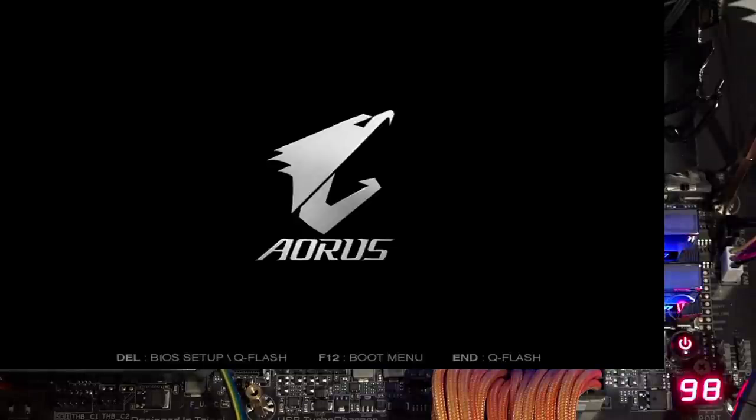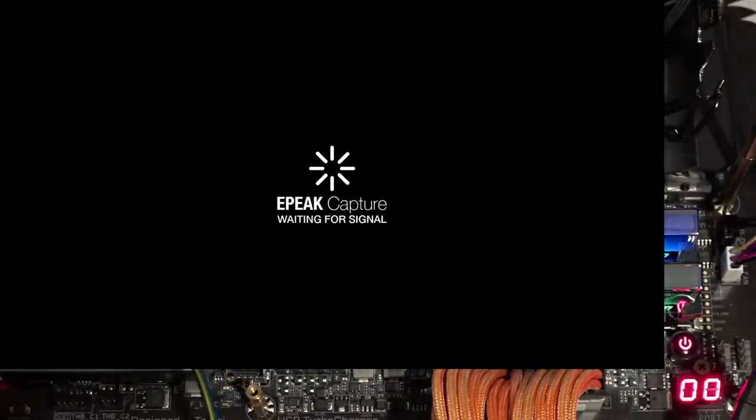I'm very tempted to just go for it. That's why you don't just go for it — it just boot-looped. We're at 101 BCLK so it's going to be at 4700 — no wonder it was having a hard time. That's actually insane. We're going to leave all the timings on auto, but I don't believe this is going to run anything once we get into Windows. Yeah, it's super unstable, so that's not going to work. I could loosen out the TRCD and that might fix it, but at some point you just get such a high clock speed that the memory controller can't deal with it. I'd probably need like 1.5 system agent to make this work, and for a long-term daily overclock I'm not going to run that much system agent on a 14nm Intel.